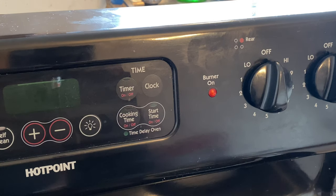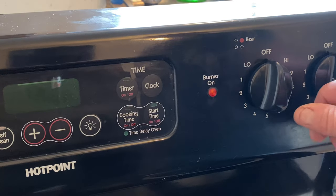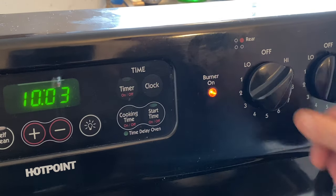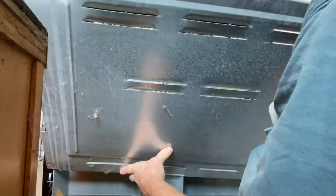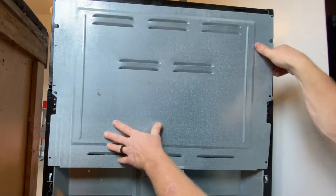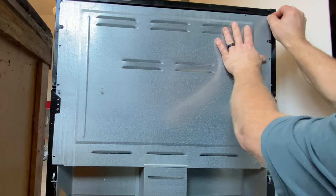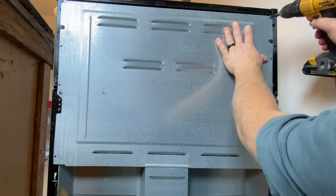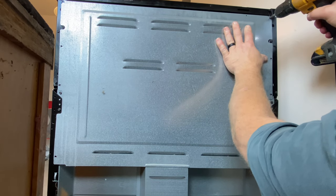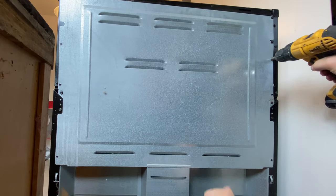So I see that was the problem. Let's go ahead and turn on the burner and see what happens. Let's pick this one — the light goes on. I'll check this one — the light goes on. So it's operating the way it should. Next, I'm going to unplug the range while I put the back cover on. I slide the back cover under the lip at the bottom and start replacing all the screws around the perimeter of the range.